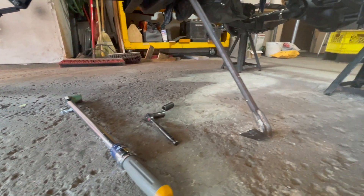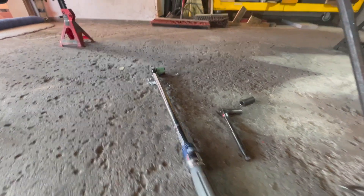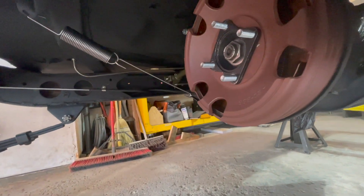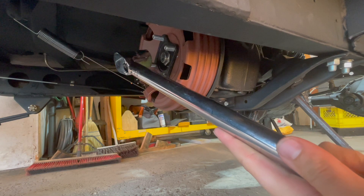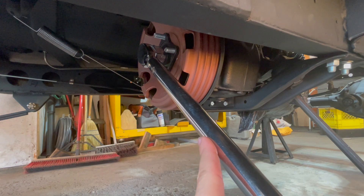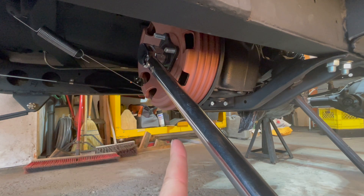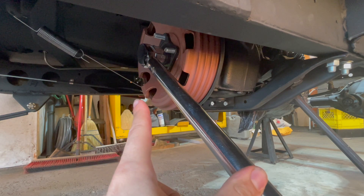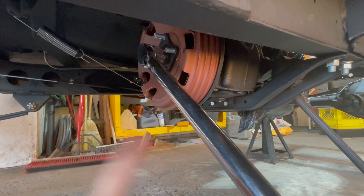Use a big torque wrench and wedge a crowbar in between the yoke in the back against the ground. When you torque this side, it'll put pressure downward onto the crowbar and allow you to torque the nut. With your torque wrench set to 65 foot-pounds, use a one-and-an-eighth inch socket on the nut and apply downward pressure until you hear the click. Now you know it's properly torqued to 65 foot-pounds. Make sure you torque this nut before putting the rear drive shaft on — you can't torque it afterward. If you replaced the emergency brake during an overhaul, don't forget to torque that nut.